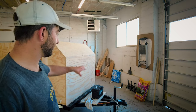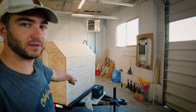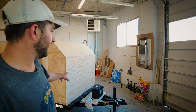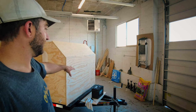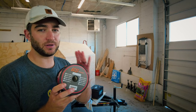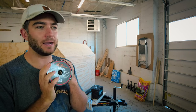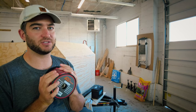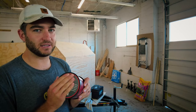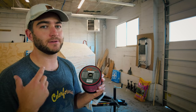In order to get my power from the tongue box into the camper, I'm going to drill a hole here on the front of my camper and use some kind of conduit between the tongue box and the camper. For this build I'm using 12 gauge wire — let me tell you, this is overkill for the system I'm putting in. I'm not running anything that pulls very much amperage at all. I think 14 gauge would be good and 16 gauge would probably be fine.